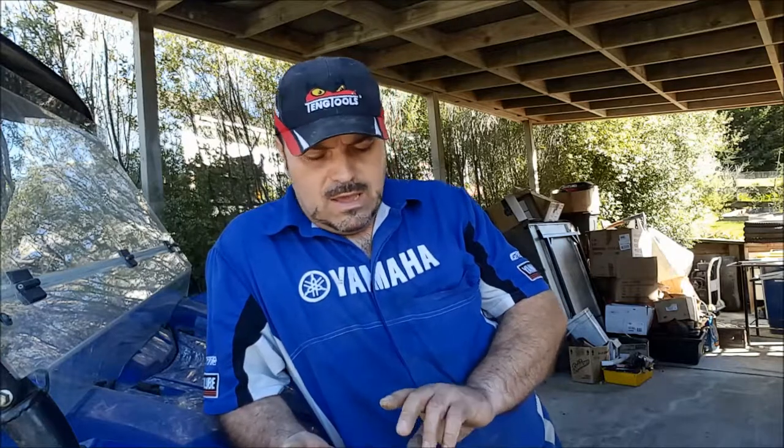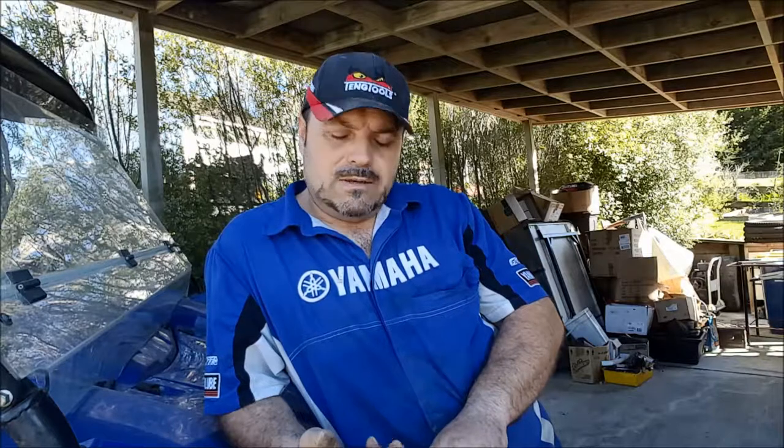And the final task we've now just finished, which was to replace the coolant fan on the radiator. Now, a previous video covers how to get that fan taken out. Yes, I did cheat. It was a bit difficult, but we pulled it off. I really didn't want to take any coolant pipes off. Didn't want to drain the coolant out of the vehicle. The radiator's at the front, the engine's at the back. There's some really long coolant pipes running all the way through the vehicle. There's a bleeder on the thermostat housing. They're not the easiest things to bleed up. It takes a while, it's quite time consuming.